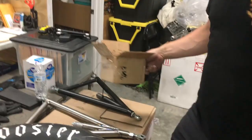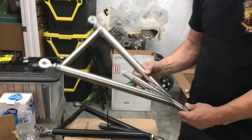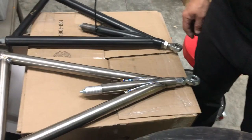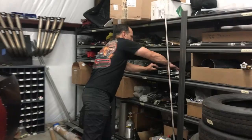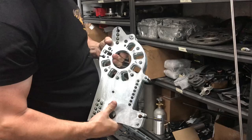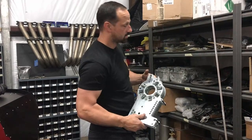We've made some changes post-Florida. We started the car off in Florida with pretty much steel components — we had a steel wishbone. We changed to a titanium wishbone, which is about one and a half pounds lighter, and about $1,500 to $1,800 by the time you get it all installed. The four-link brackets we changed as well — this is our RJ bracket; they make these and they're available to everyone, but we have them installed on the rear end straight from Strange. By changing to the titanium bracket, it's about $300-$200 but saves about seven pounds — some of the biggest savings we had.